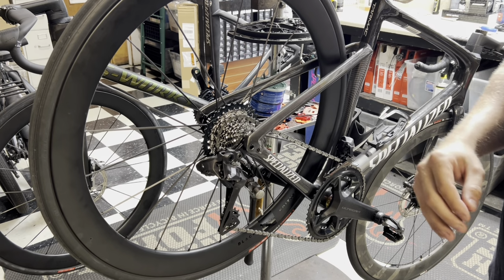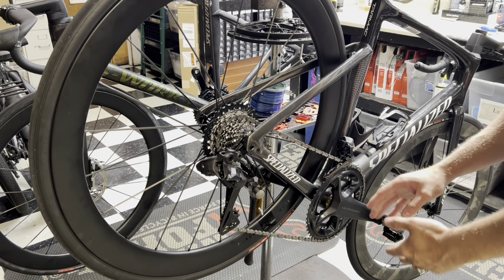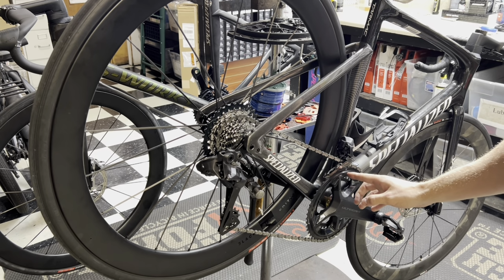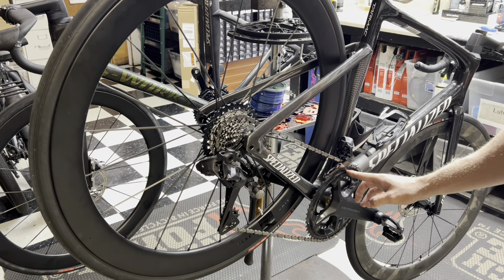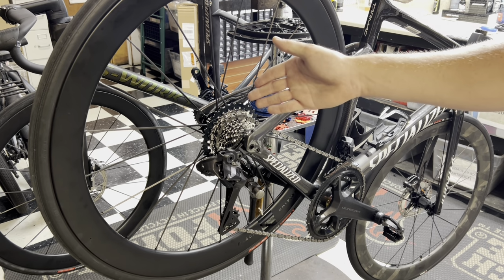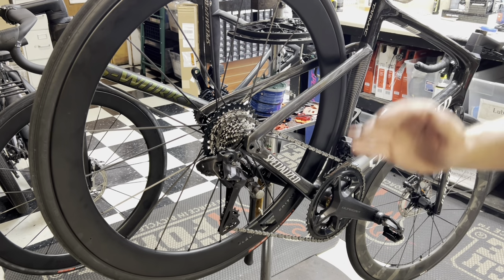A lot of people don't like the front crank situation that SRAM Axis comes with because the chainrings are smaller, since they want to utilize this 10 tooth better. But with the Shimano crank configuration, this being a 52-36, meshing a 52 tooth big chainring with a 10 tooth cog should give me about the equivalent of a 54-11 or 55-11 Shimano chainring. Then going all the way down to a 36-33, that's like running a 34, I forget the configuration, but it's like having a granny gear, a climbing hill gear. I'll find out the exact one.